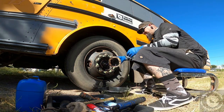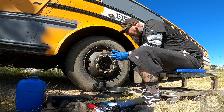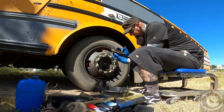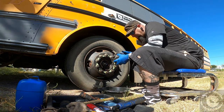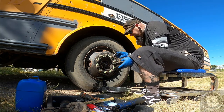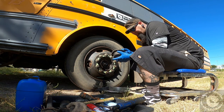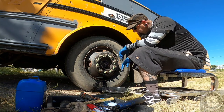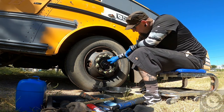The old housing is off. Didn't lose as much oil as I thought. Most of the gasket came out with it, and I can see it's actually been taken off before — whoever replaced it last didn't use the right gasket. They just used rubber sealant, which is absolutely not the right way to do this. I've got to scrape all that old rubber sealant off and get everything cleaned up.